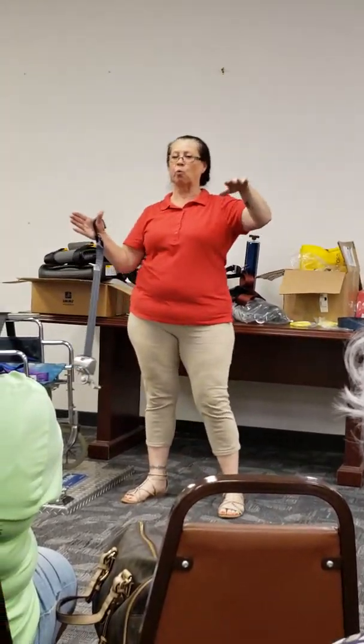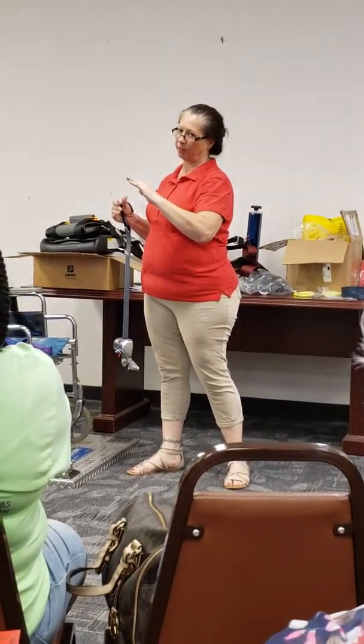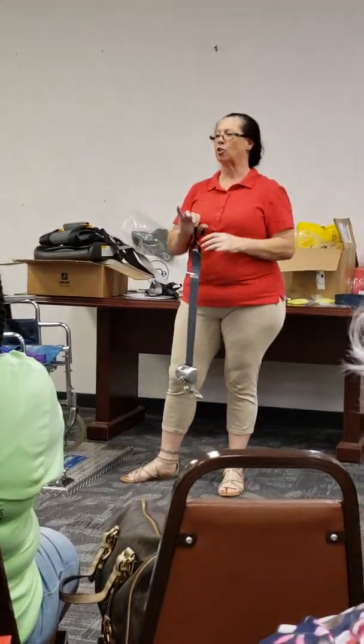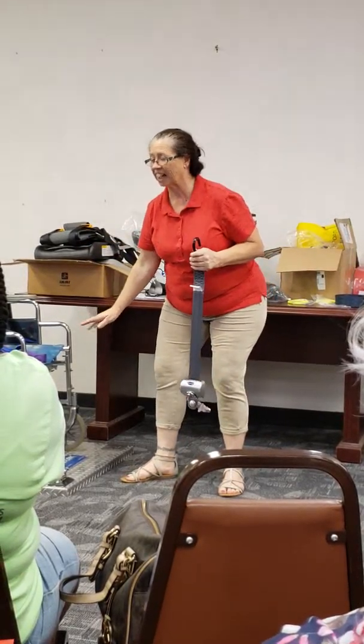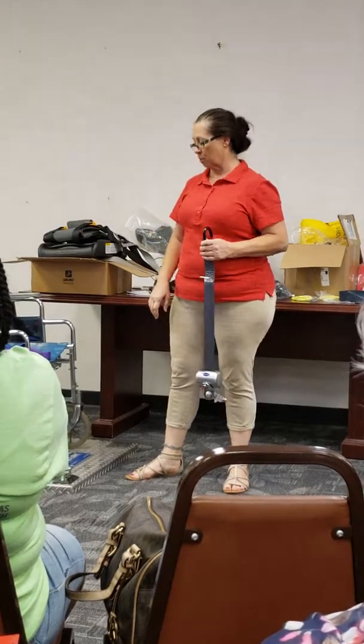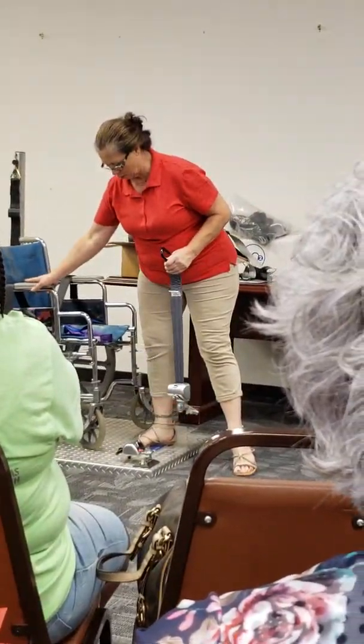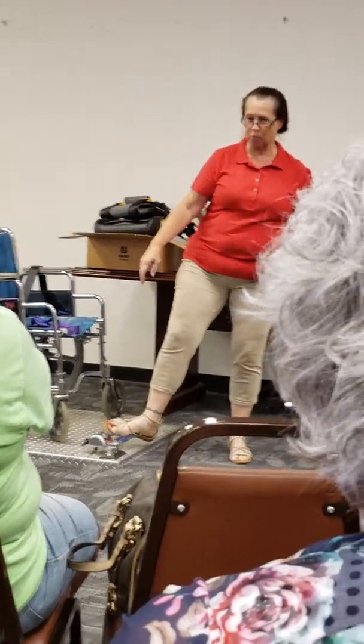Because we have to have 4 tie downs. The front 2 are meant to hold it down, but also to control the shift. Because even in the new style wheelchairs, we still have that rotating front wheel. So we have to control the shift. Therefore, the fronts are always outside of your front wheels. We want a 45 to 60 degree angle from the floor.